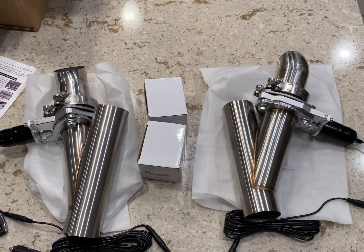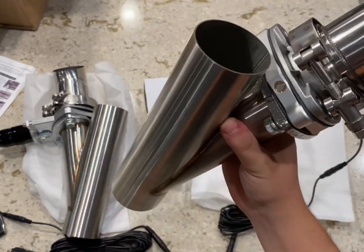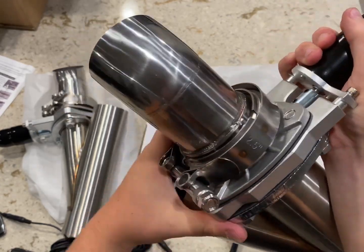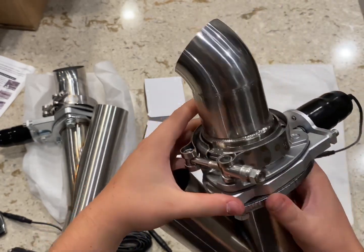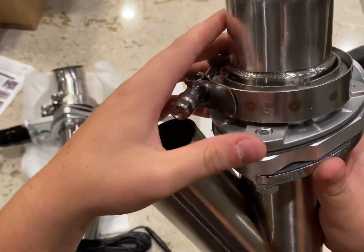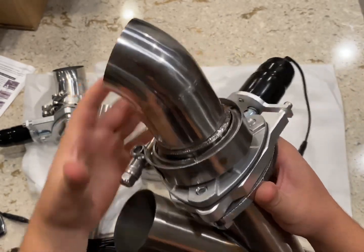Okay, so I've installed both cutouts. These are what they look like. They provide you with the 2 gaskets which go on either side of the motor. I've left all the screws just hand tightened so I can adjust them as needed. And for these ones especially, put some Loctite on them to make sure they stay in there. This I will position when I get it under the car.